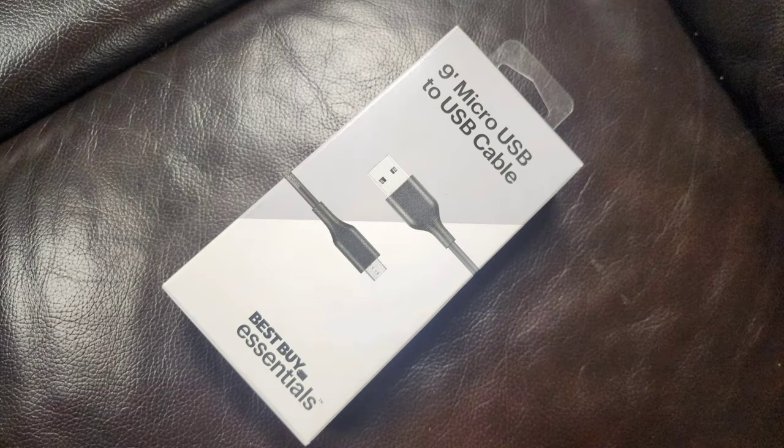You also need a micro USB cable — the micro USB connection is on your Reflex and the other end connects to your laptop. Keep in mind that if you grab a random cable from around your house, it may not work. You need a cable that has data connection — some are built for charging only. If it's a charging-only cable, it can power your unit but can't send data, and you obviously need data transfer to flash a tune. I recommend going to your local store and buying a new phone cable, as those almost always support data. Also, if you get a long enough cable, you can leave it plugged into your Reflex and run it through your firewall so you can access it from inside the car — put your laptop on the passenger seat and flash without removing your interior panels.